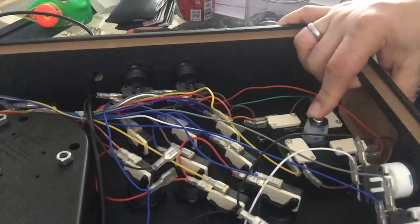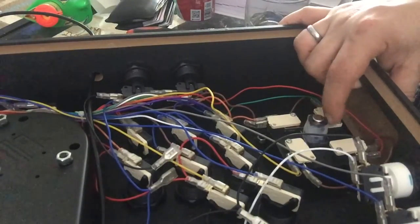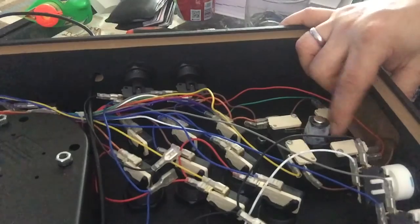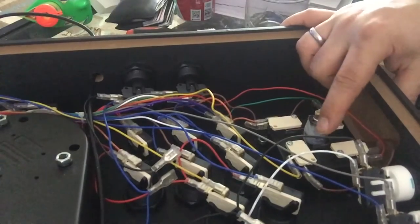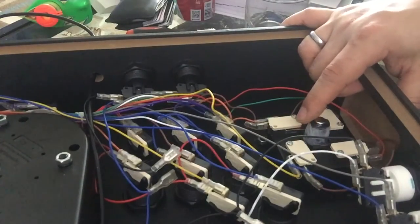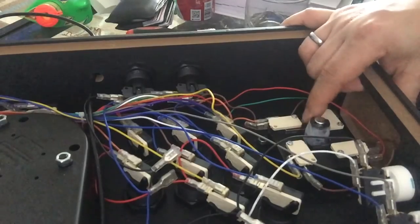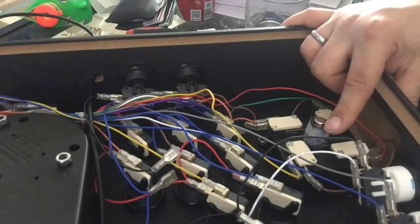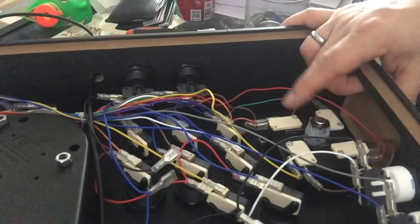These joysticks are knockoffs of the HAP Ultimate competitions, whatever they're called. Just because it says HAP doesn't mean every joystick product they have is going to be good — they have a HAP with this round bushing and it's just as bad as this. If you're playing Donkey Kong or games where the joysticks only take four-way signals — up, down, left, right — you could probably get away with it. But if you're playing Street Fighter, Sinistar, or Robotron where there are many points on your movement patterns, you don't want this. You want either an optical joystick or maybe the IL Euro sticks.